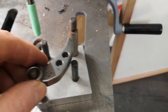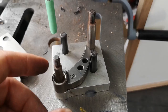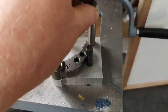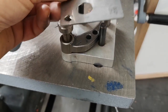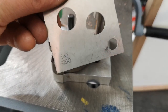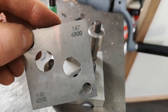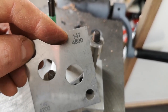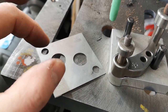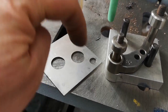You would put the ramp in - it's made for Skidoo and Polaris. You would stack three ramps and then put the appropriate spacers on, and it'll go something like this. Here is a ramp grinding template. That hole here would give you on a 147 ramp 4200 engagement. This hole here on a 147 ramp would give you 4800 engagement. So there is a different angle on the geometry here in relation here to here. You just turn it around and grind for the different engagement.